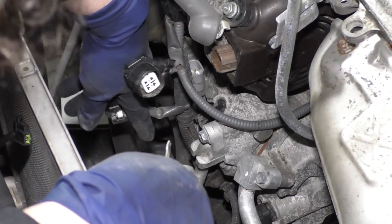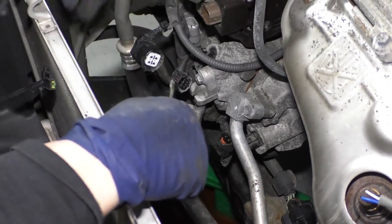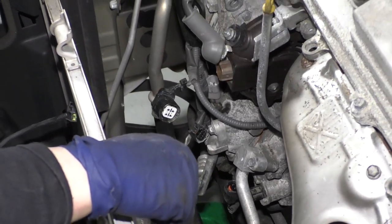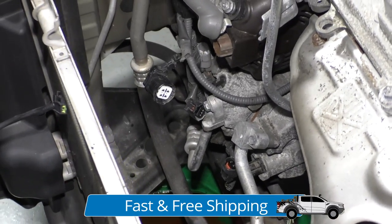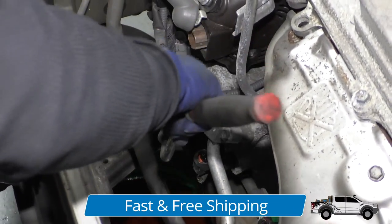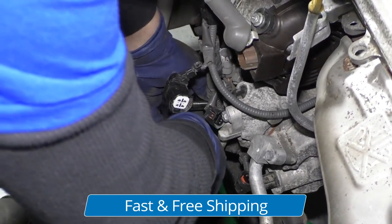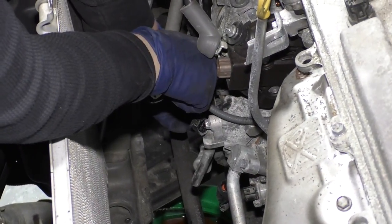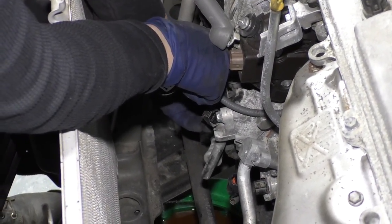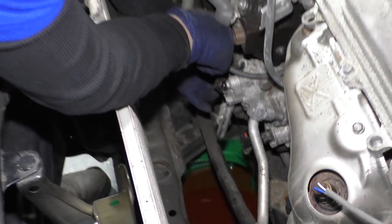And then one right here — you can hear the sand crunching. Now there's a bracket that holds all that. I'm going to grab my 10 millimeter ratchet. I've got one more bracket down here. At this point I'm going to move the coolant catch bucket because I foresee tools and bolts going for a swim — we don't want that.